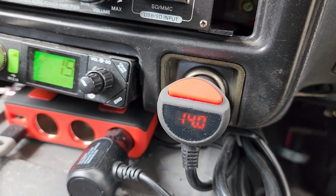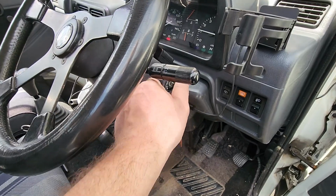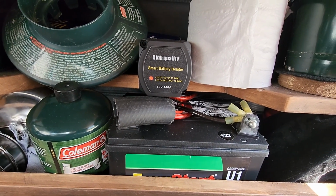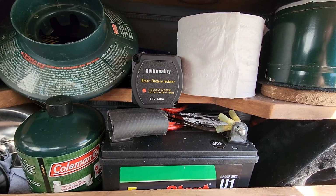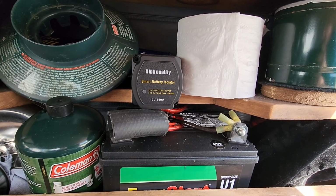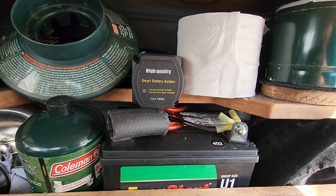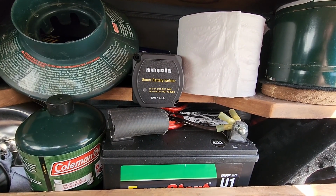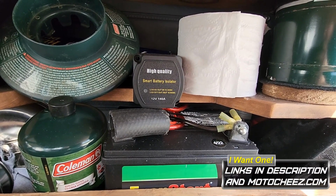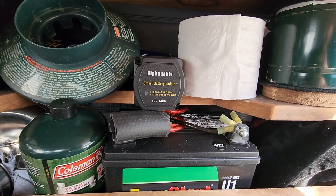That's not too bad. 0.8 volts, 0.9 volts. So I'm going to shut this off. And since the battery was charging, it's going to be overcharged a little bit. Even though it's a 12 volt battery, sometimes you'll have like 13 volts or more. Oh, there it goes. So apparently it dropped down to 12.8 volts and then disconnected the two batteries. So that saves my main battery. So I'll never get stranded, boys. Well, not from a dead battery, hopefully, anyway.